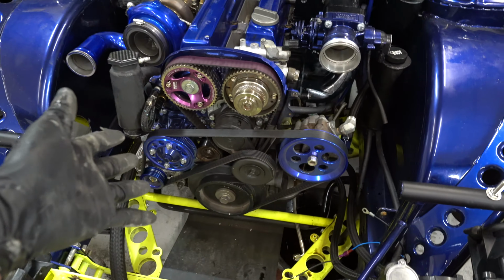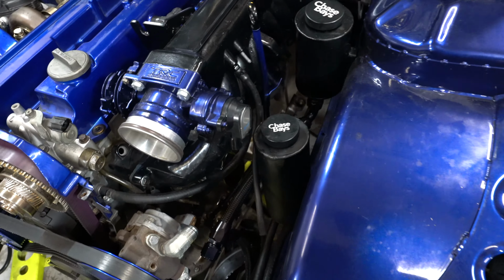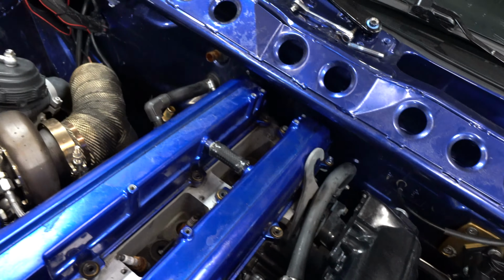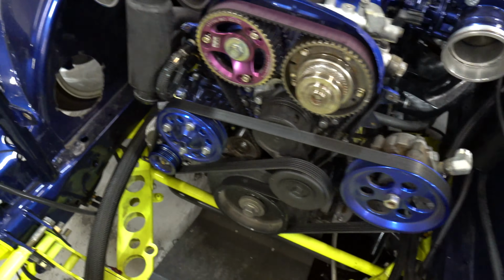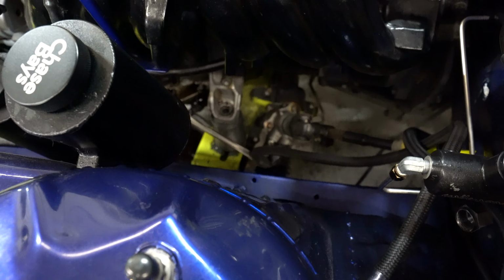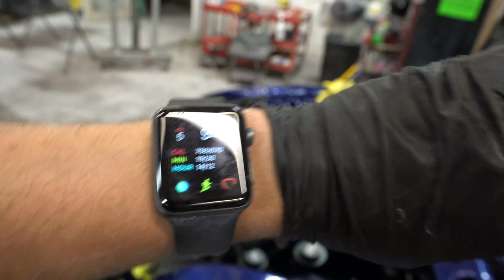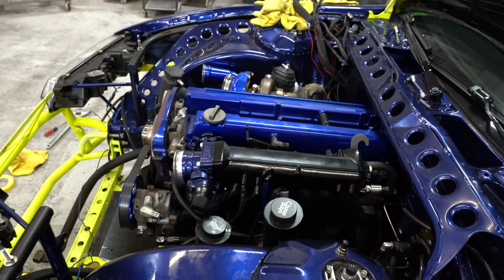Of course, at the front of the engine, there's nothing to unfasten. And on this side, we got the oil cooler lines disconnected. Of course, the injectors had to come out because the harness had to come out. That's how we got it over there. But looking at it, there's nothing else to disconnect. Even the motor mount bolts are disconnected. So it's basically strap a chain to it, undo the tranny bolts, and this thing's coming out in less than 2 hours. That's pretty cool. So I guess it's time to drop some bolts and yank this sucker out.